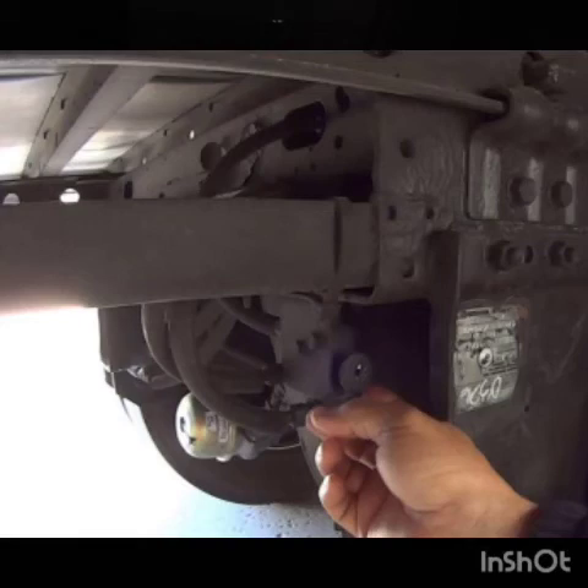If you're in a city with a lot of traffic or a very small truck stop nearby, you should still be able to pull in there and slide your tandems with your four-way flashers on. In tightly packed truck stops in the upper eastern US where there isn't a lot of space, I wouldn't recommend stopping traffic, but if you really need to slide your tandems, put your four-ways on. After driving from that shipper or receiver, you're going to have enough air to slide your tandems.